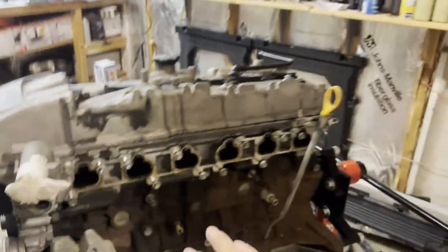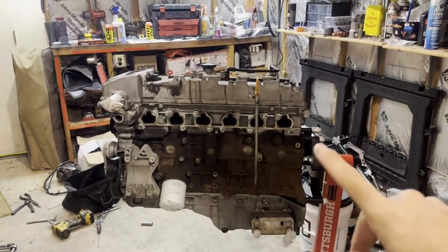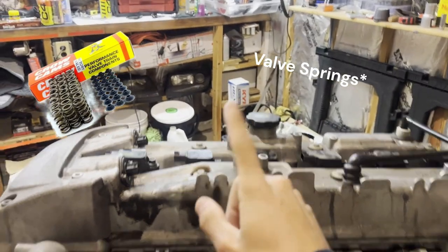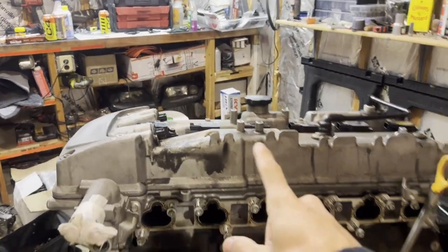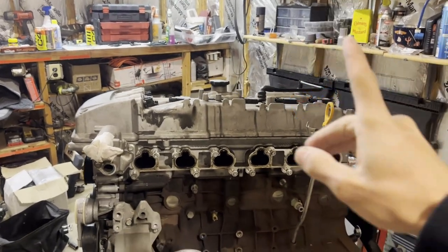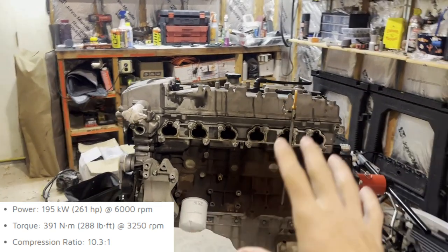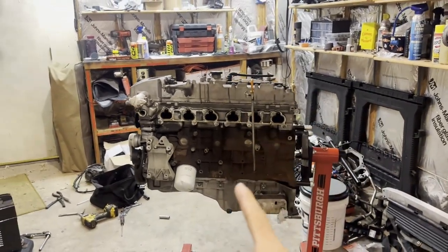But if I wanted to, as soon as it came in with all the intake and headers and whatnot, if I just plugged it up, this thing would have started right on. For this to make any power, it's super easy and super simple. We'll start from the top and work our way to the bottom. For the top, we need to get heavier lifter springs. We can get different retainers — we may or may not go titanium retainers. Then directly after that is ARP head studs; we do not want to lift the head. As soon as you start adding boost to NA motors, they like to lift a little bit. As an NA, this made 260 horsepower and 280 torque. These are torquey motors — they always match if not exceed the horsepower and torque rating, and that's what likes to break stuff.